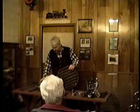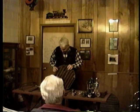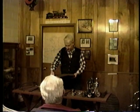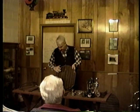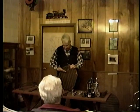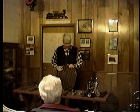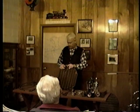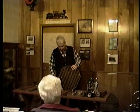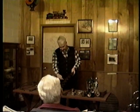This is basically the design of the 1903 burner grate, cast iron with these inverted ridges. It would have been like so in the burner. And what they did was they put this on a milling machine with a saw blade and they cut slots across these ridges, I guess about a quarter of an inch apart or so. And the fuel came through the nozzles and through mixing tubes that went in here.